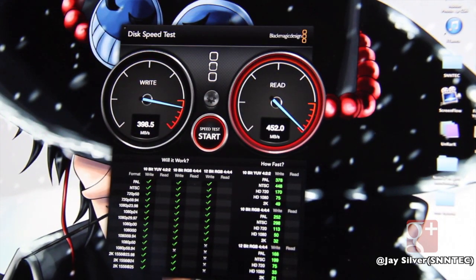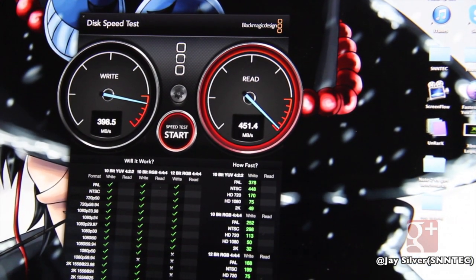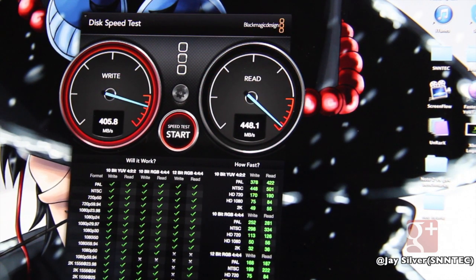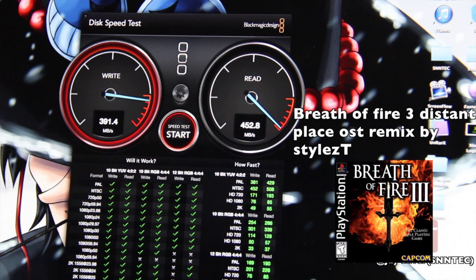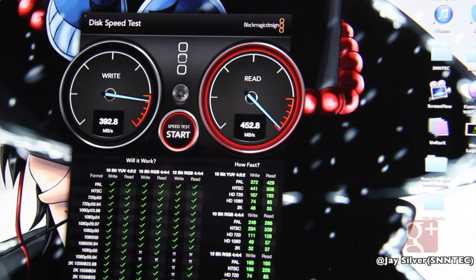To give you an example, a traditional hard drive will read and write about 80 to 100 megabytes per second, while a solid state will give you around 400, maybe 500, but usually averages about 300 to 400 megabytes per second. And with that said, you're going to see the bottleneck in every system reduced. Back in the days when solid states were very expensive, everybody took a regular traditional drive. For one, you get massive storage for a much cheaper price, but it's usually the bottleneck because, like I said, no matter if you get a 6-core processor or a high-end quad-core or hexa-core processor, you're only about as fast as your bottleneck piece, and Apple looks to remedy that with a solid-state drive, which was usually the bottleneck in the older MacBooks.